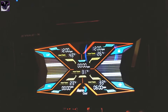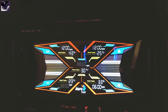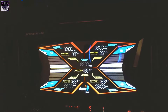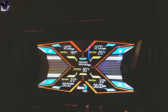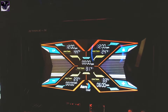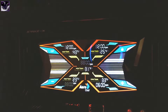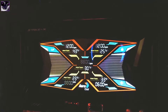How it's connected: number one in the middle is GPU — that's on top of my graphics card. Number five is between my RAM sticks. Number two is between the motherboard, which is kind of hard to position. Number four in this corner is between my back radiator — the radiator for the H100 CPU cooler. Temperature three is ambient temperature, just inside the PC, sitting apart from the front fans so it doesn't get any airflow — that's just neutral temperature.